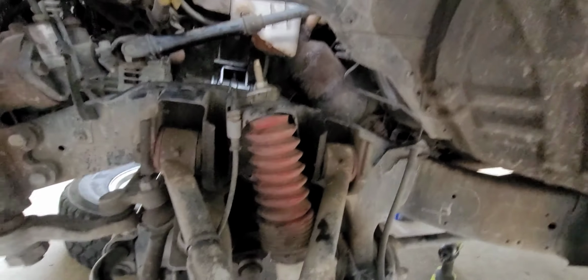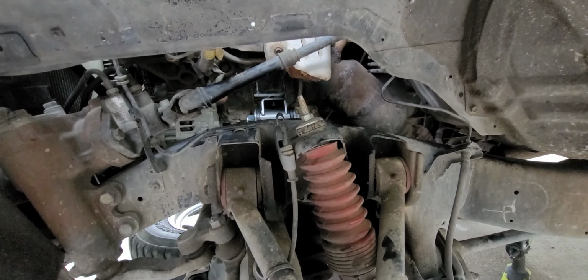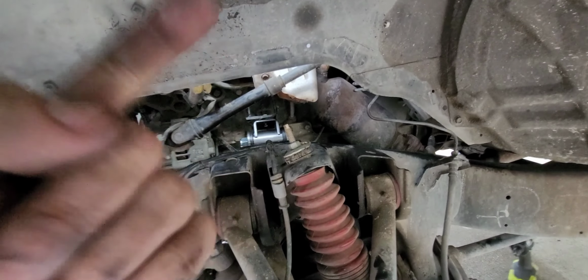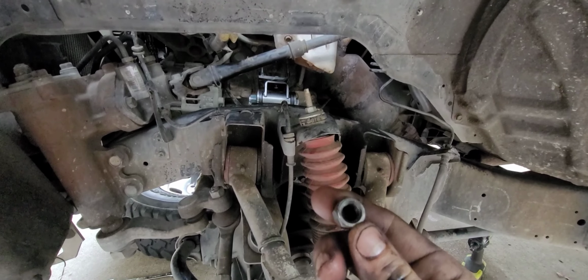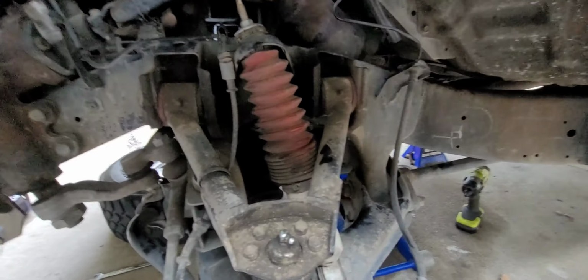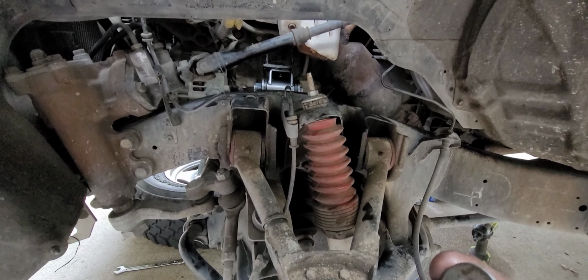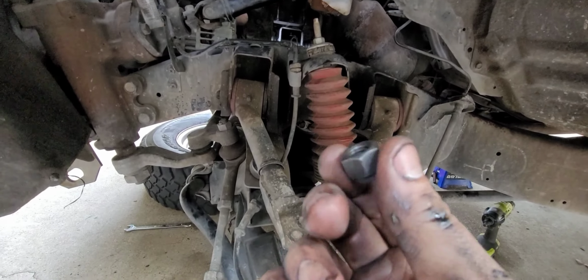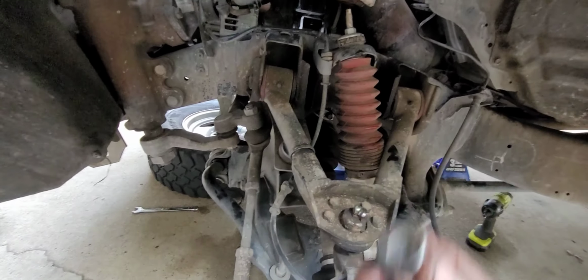Okay. I have two gripes when it comes to the rugged rocks or rigid rocks, whatever, the poly mount. There's no washers. There's no, like, crush washers, nothing. It's just straight up lock nuts, which aren't bad. It's just weird. So I found this type of nut with the bevel, whatever, this guy, and I put one on top just for now. I'm gonna try to put one of these underneath, but it's so small I might just do it from the front. Maybe I can just get some more access to it, but we'll see. I'm gonna put one on the back like this so it has better clamping force.